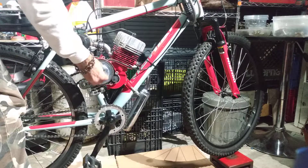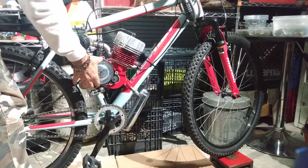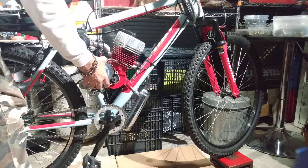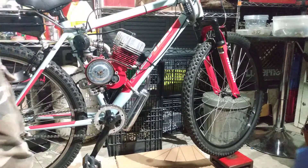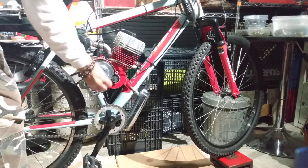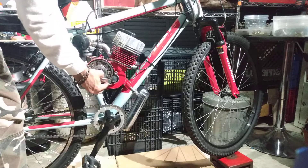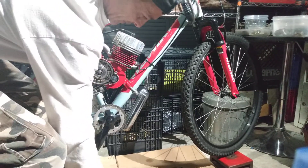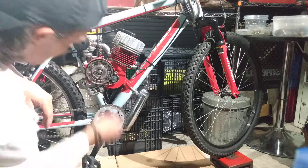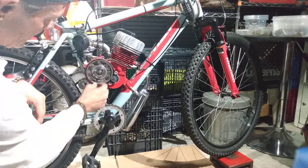Let's take this thing off — let's loosen it up first. Just loose. I'll take this pressure plate off, clutch plate, whatever you call it. We got stuff falling on — that's because I cleaned up the grease off of these. They lubed the crap out of it and the grease went everywhere, so I had to take all these out. And I didn't like their shape, so I filed them down.